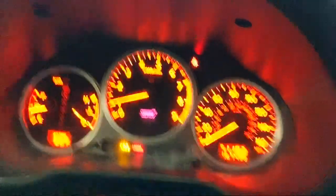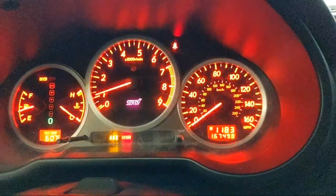I remember my CTS-V - it was a version one that didn't come supercharged and I built the motor. I stroked it, which was probably the wrong thing to do, but I got such a good deal on the stroke kit I couldn't pass it up. It was a Magnusson MP1 13 or something like that - an older roots-type blower. It made a heap of torque. What was weird was the boost would climb towards the end of the pull. That's not what a roots-type blower should do.